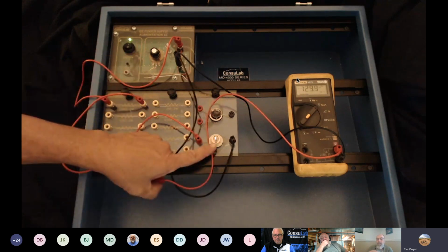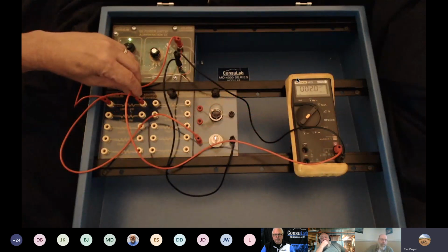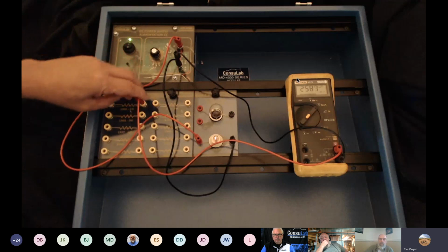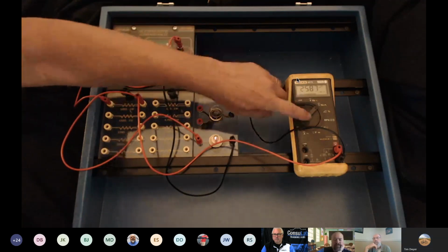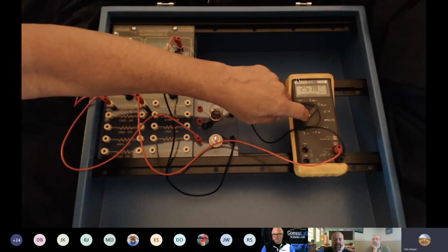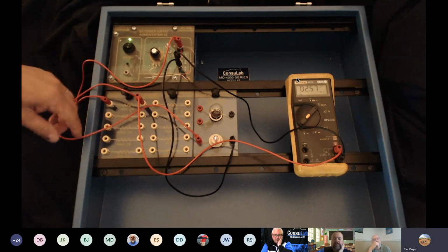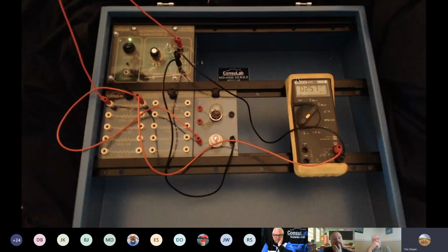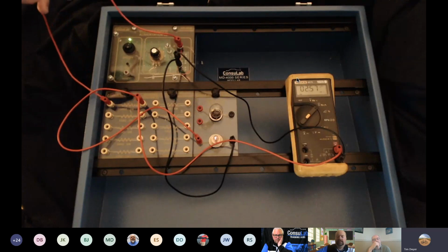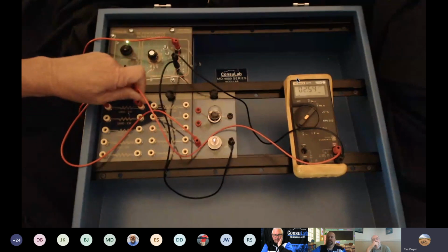Well, we have current because we can see we're lighting a bulb. We have voltage and we have amperage. So right now we're passing current through this resistance, and on the back side, I don't really know how many volts we're going to have. I need to go back to my other scale there. So almost 2.6 volts made it past that resistor. So as an electron, I rationed my voltage out. I saw that I had 12 to spare. I probably dropped 10 on this. Yep. I made it through with 2.6.